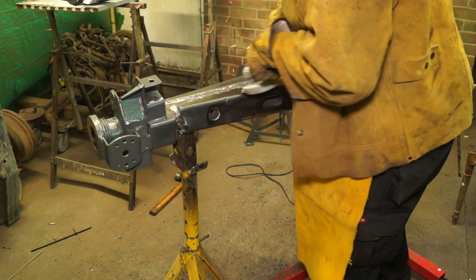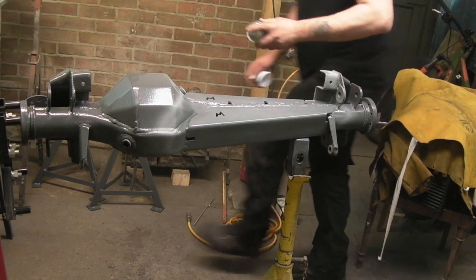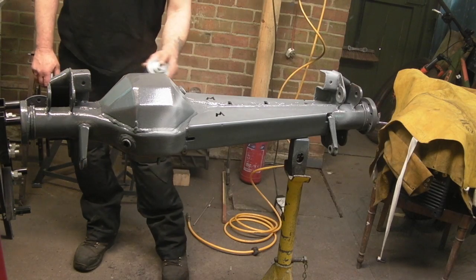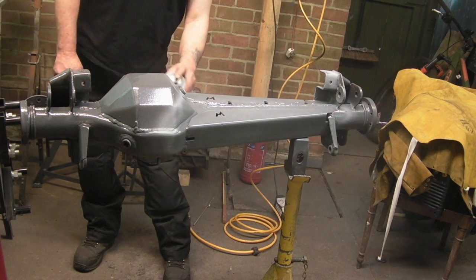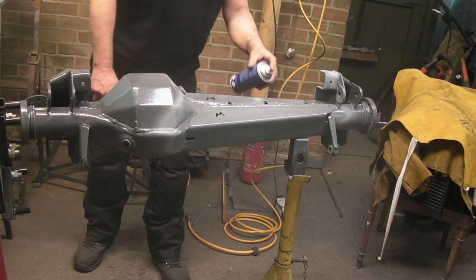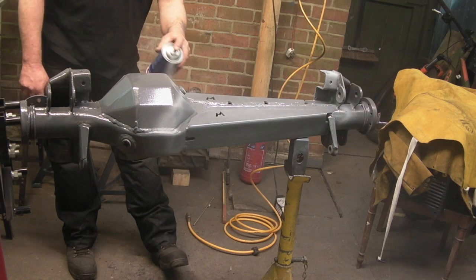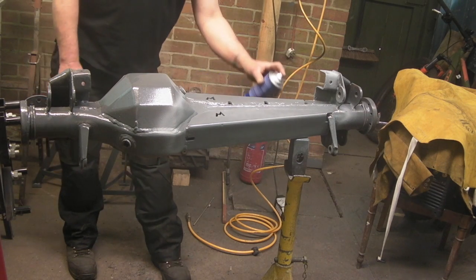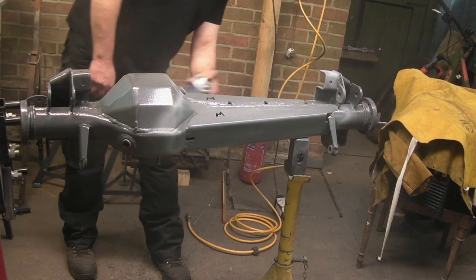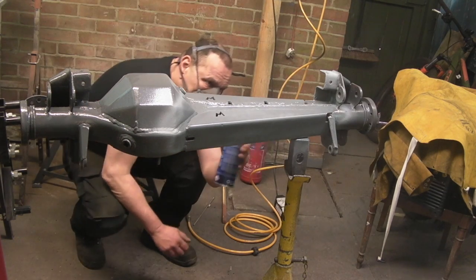Once done it's clean steel — once you've polished it off and got the mill scale off you can primer it. I'm using a heavy zinc content primer. It doesn't need something like Corroless or Buzzweld RCP because there's no rust on it. Painting inside — you'll have to use your imagination on that one. However, this is a good modification for those who really need it.